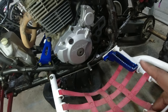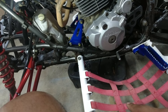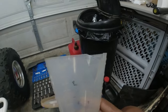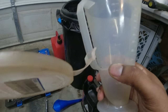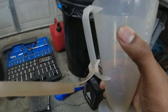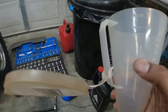All right. All the oil is drained. Block, oil canister, and whatever little oil was left in the oil filter housing with the new oil filter. Draining and filter change, 1.85. I'm just going to put two in there. I buy my GN4 by the gallon. 2 pints is a quart, and this biggest measurement is a pint and an eighth. So I'm going to do 3 pints, which will be 1.5 quarts, and then I'll figure out whatever it is